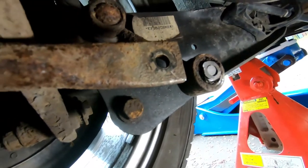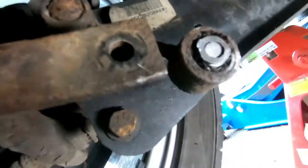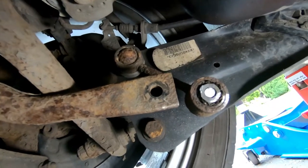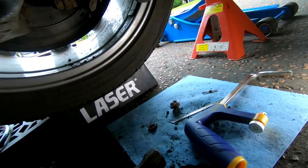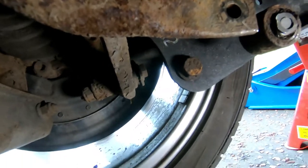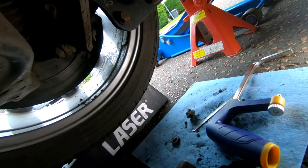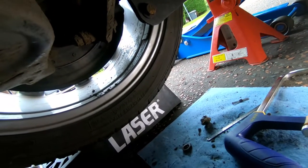Now on the passenger side of the car - you can see the drop link being cut off and the anti-roll bar just there. This one was seized up quite badly, so saving time I just cut them off. There's a bit of debris - I did actually snap the hacksaw blade; it got caught between the two parts as they were starting to release and ended up shattering. Nothing major, keep spare blades. A good hacksaw does go through the bolts, and of course I also have the Dremel with the cutting wheel.